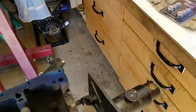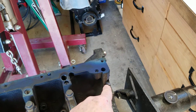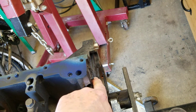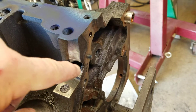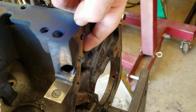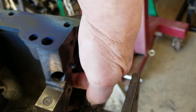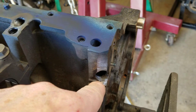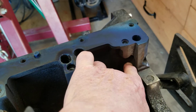To review what we've done so far: we used a quarter-inch bit to drill a pilot hole to intersect with the oil passage in the back of the block, right down there. We eyeballed that and got it intersected. You don't want to go too high because this recess is deep, and you don't want to break through the casting on the low side. There's a recess but it doesn't go quite that deep — it actually tapers away from where we're drilling.